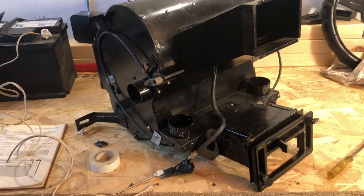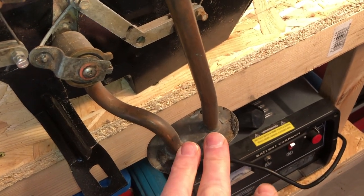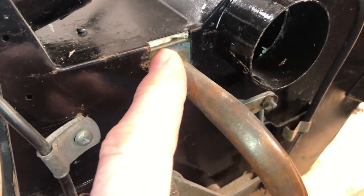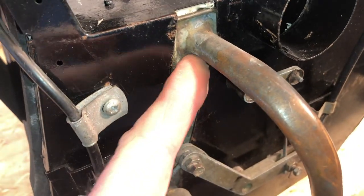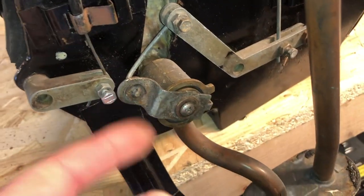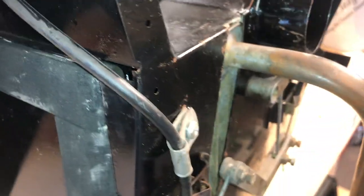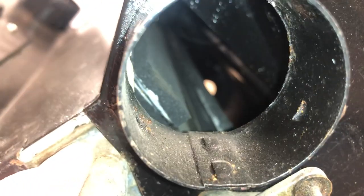There are three pins — the other pin gives half speed. Hopefully that gives you an idea of how this whole thing works. The pipes from the bulkhead and engine feed come through here, and you can just about make out the side of the heater matrix — it's like a little mini radiator, not very big at all: a couple of inches wide by six or eight inches long. The air goes through it just like a radiator and warms up. I've put some foam on there to protect it, and it's situated on the left-hand side inside.